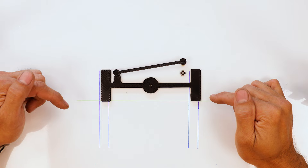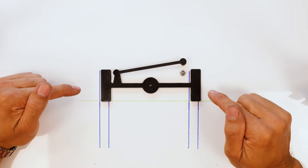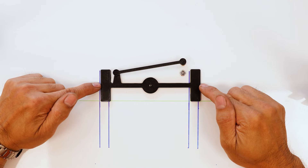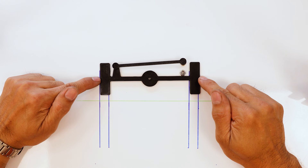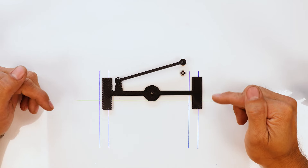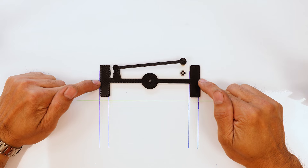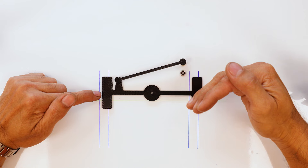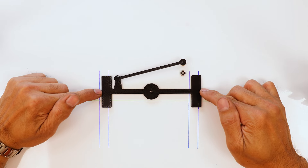This is at the normal ride height and this is quite obvious on vehicles. If you've got a 2-inch lifted vehicle, go outside and have a look and you'll see that your tyre is shifted over to one side a little bit. As you go through the range of suspension travel, up and down, the actual lateral movement is increased — it's not optimal. Having the Panhard on an angle means you have more sideways movement in the axle.